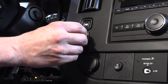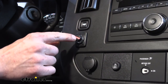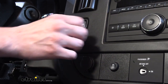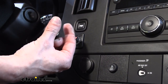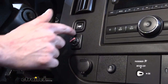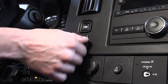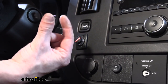After that, we're just going to install our knob. We'll turn it fully counterclockwise, line the zero up at the top, and slide that into place. Then just verify your button clicks. With this mounting location, if you've got the nut tightened down and you didn't cross-thread it, everything should work out very well. I like this mounting button because sometimes your panels, depending on their thickness, you may not be able to press the button if the panel is too thick. So this way, using this mounting location gives us a preset mounting thickness on the button mount. You know it's going to work no matter what — it kind of turns any panel into a usable panel, even if it may be quite thick.